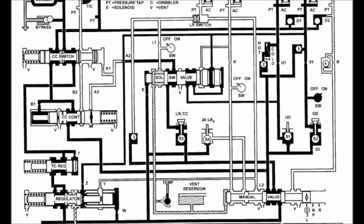Now this may happen because a lower gear has been selected with the shifter, or also in the instance that the vehicle is overheating. If it is in an overheat strategy, then the cooler will also be used to its complete maximum, and the direct gear will enable the torque converter to stay on completely, even into a second gear shift then, in efforts to hopefully cool down the transmission by not using the torque converter as much.